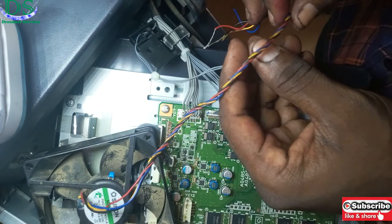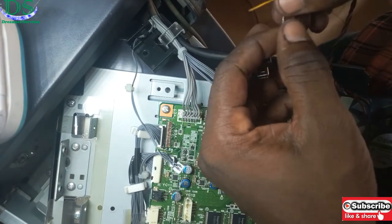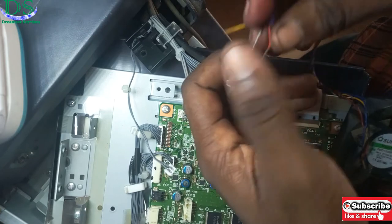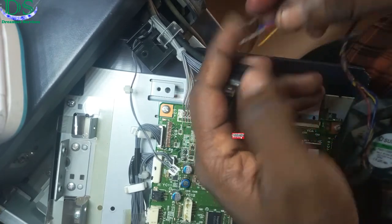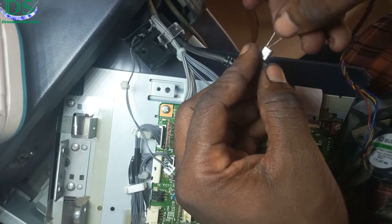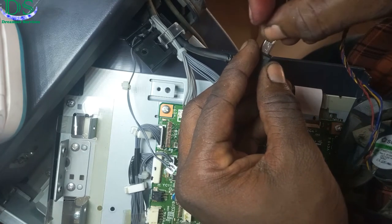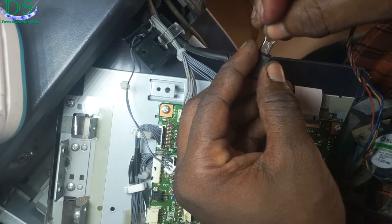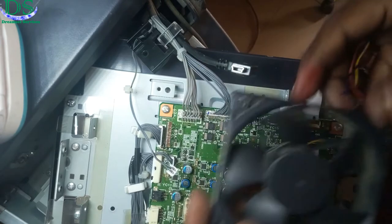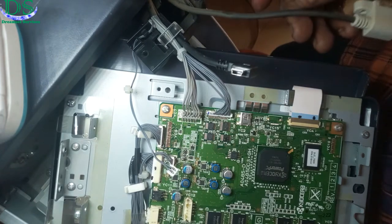You can see I'm using the fan to check for power. There is no form of power coming into this board. I'm going to check each of the cables one by one — look for the exposed metal part of the cable you're working on. Get the positive and negative leads of the fan and carefully place them on the positive and negative of the cable, then check if the fan spins. I'm only showing you this if you don't have a multimeter; ideally you should use a multimeter to test the voltage coming into the board.